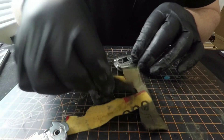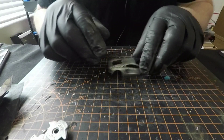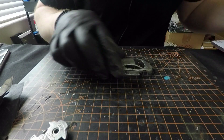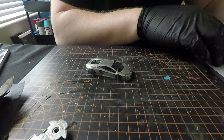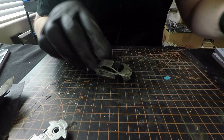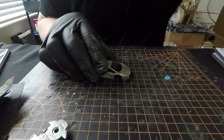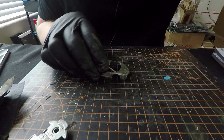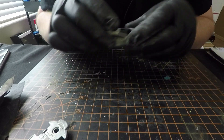I've got my stack of old sandpaper here to move aside. We are moving to 3000 grit, and then we're going to do 5000 grit. And then we are going to use a polishing wheel on a Dremel tool and use some mag aluminum polish to polish it. And then we're going to use a swirl remover and wax just to finish it off. So here we go.